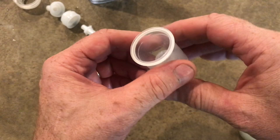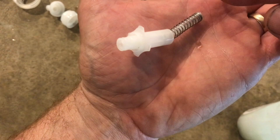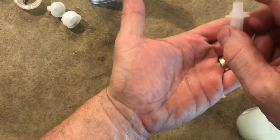This is the pickup tube that actually picks up the soap and it's the outer portion of the cylinder. Now look closely here, there's a real small clear ball right here. This is part of the one-way valve that allows the soap to be sucked up in one direction but not the other. So when you take your hand and you push down to get some soap, this allows that one shot of soap.